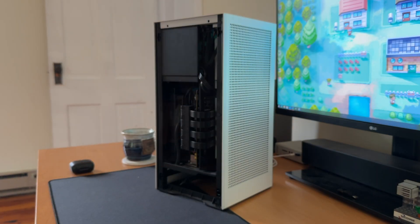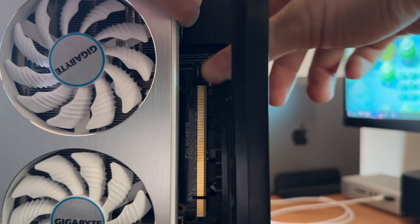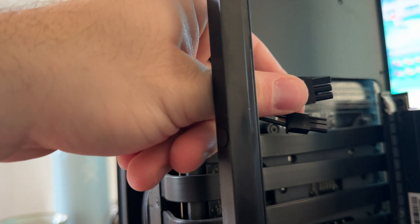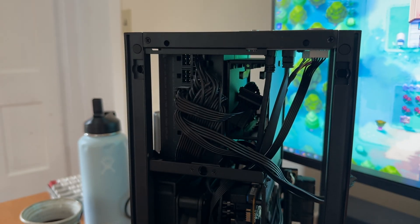Getting inside of this machine is really easy — it's just a matter of taking off the front panel, the back panel, and then the side panels. Once I got inside, there are two thumb screws that I loosened to release my GPU. Once I got those thumb screws out, I just pressed down the little gray tab on the riser and slowly wiggled out the GPU. If you want to do this at home, do better than me and unplug the power to the graphics card before you remove it from the riser. From there, I just popped the cover off that is hiding all of the extra cables and the caddy that the 2.5 inch drives sit in.